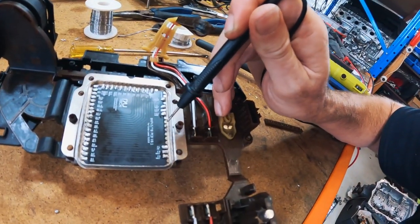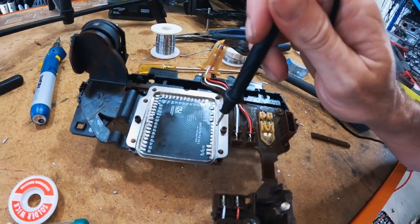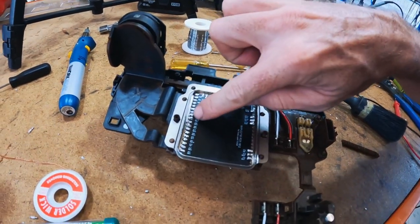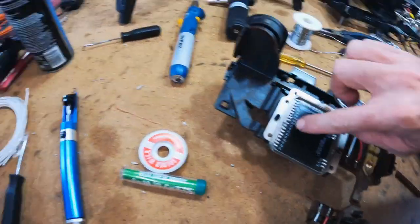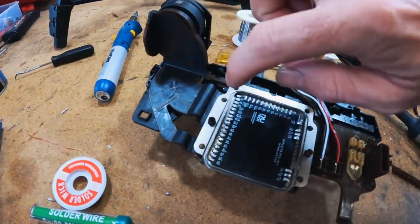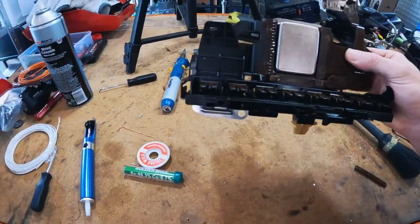They are, like I said, insulated from the body, but basically these four were all shorting out, so I ended up removing them. They are pulled out completely, and I've replaced them with little bits of wire. Now that is PTFE, it's a really good wire that I'm using, but basically I just pulled the prongs out, drilled through, and now they are directly connected on the back there.